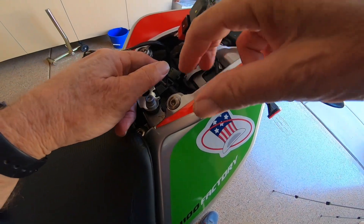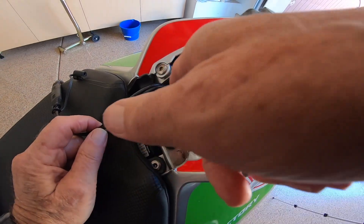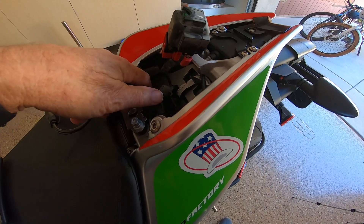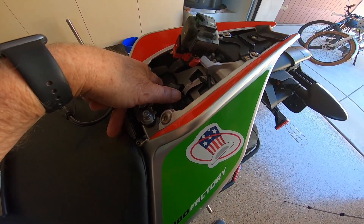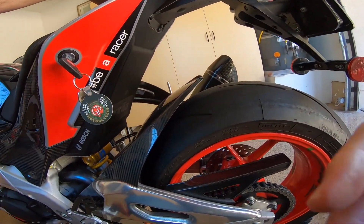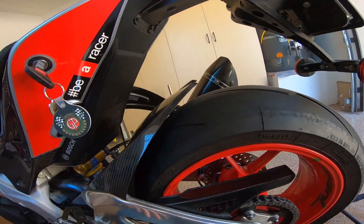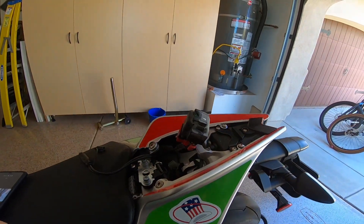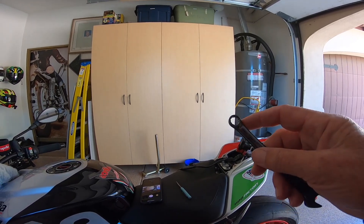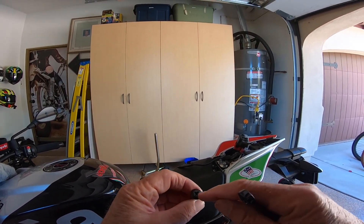We've got to take some nuts and bolts out. I'm not entirely sure how well these will show up on camera, but that's where they are, so we've got to try and grab them — and that does not look like it's going to be too easy to get to. One, two bolts corresponding down here under the device, and then a little beauty washer. This is a 10 millimeter, and a multi-point boxed-in wrench is nice to reach down inside there. You've really got to go down into the depths of it. So, 10 millimeter and a regular old big honkin' Phillips head.